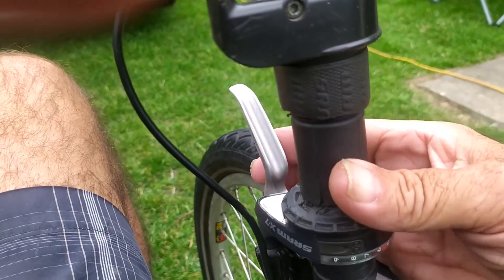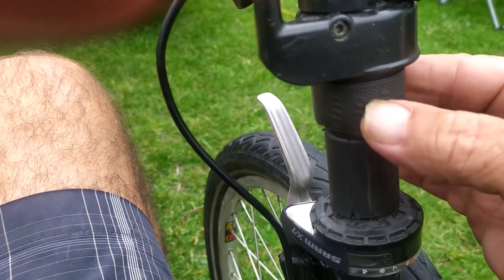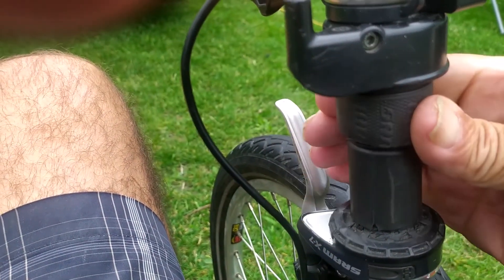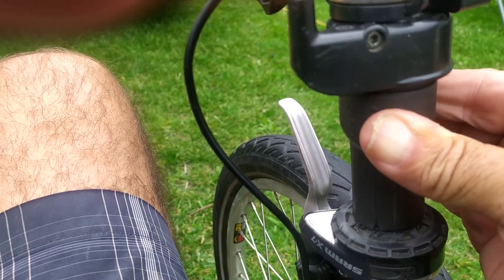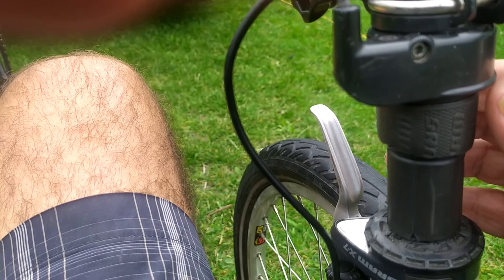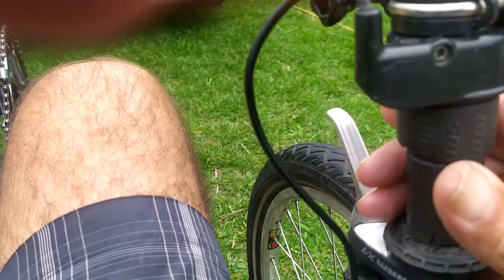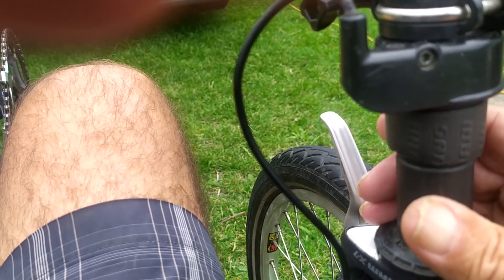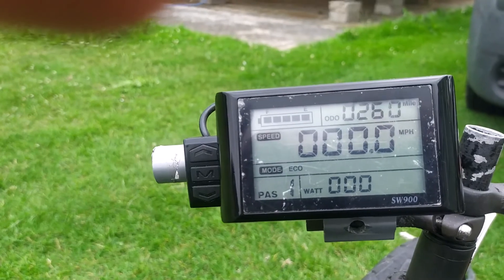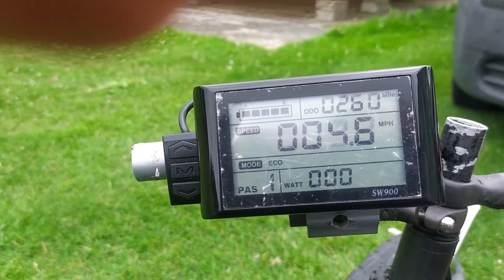Over the other side is where I put the throttle. As you can see, I mounted the throttle upside down above the gear change — just move the GoPro adapter out of the way — so you can change gear on the bottom part and use the throttle control on top. As soon as you release the throttle control it goes back to zero. I decided not to put the brake levers on that automatically stop the motor, because as soon as you take your hand off the throttle it stops anyway.